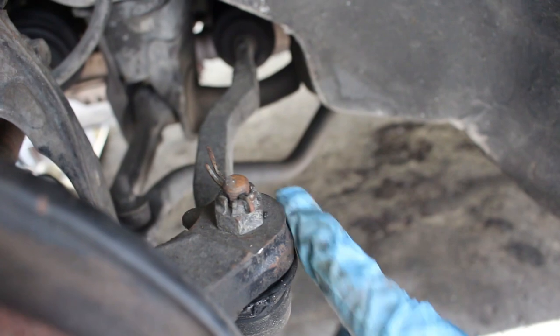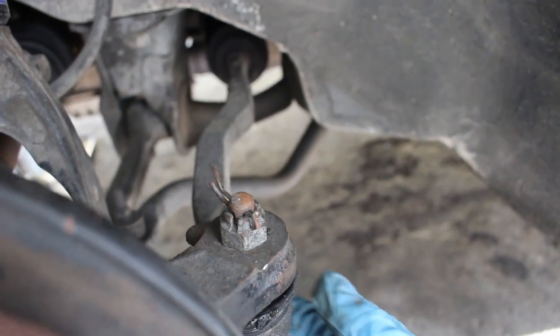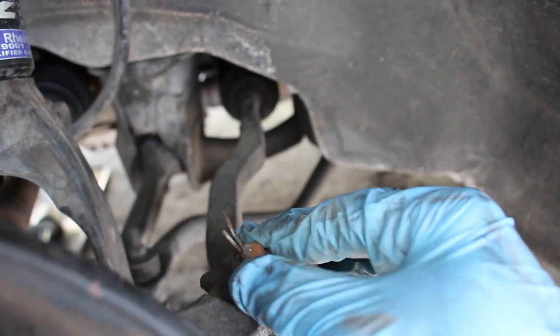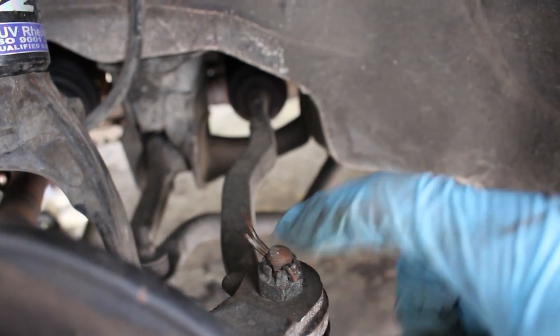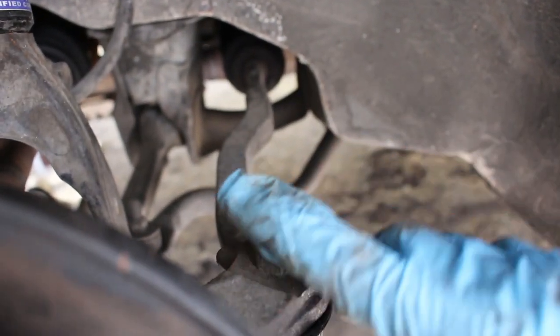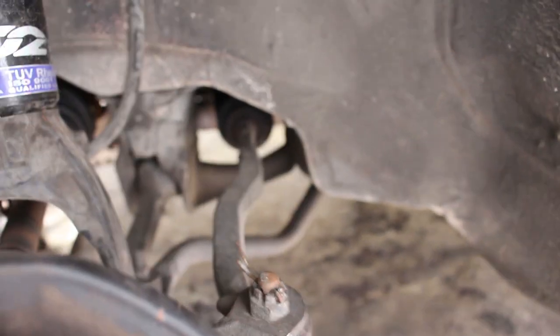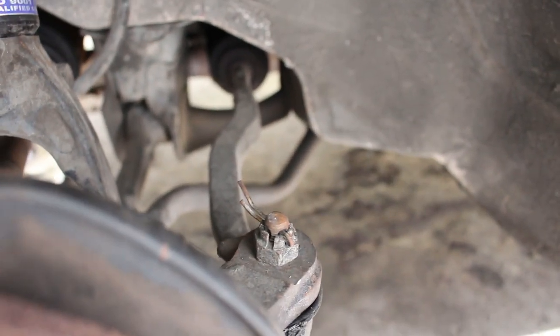I'm gonna go ahead and hit it on this little piece right here, and eventually it'll loosen up and you should be able to take the tie rod off. If you can't do that, you can get this castle nut, put it upside down on the little stud, upside down till it's flush, and then you can hit that and try to hammer it off. But be careful and don't mushroom the threads here,